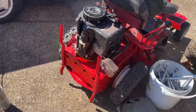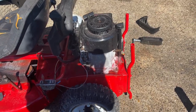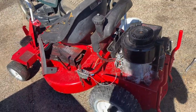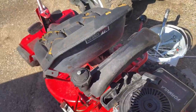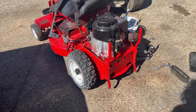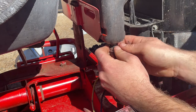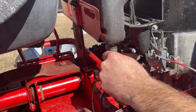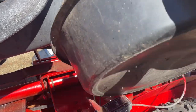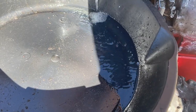So we've got a dirty carburetor - that's the problem. I'm going to try that a few more times; sometimes old gas gets in the bowl and once it gets fresh stuff from the tank it runs a little better. If that doesn't work I'll drop the bowl. I'll drain this gas out and put in some good non-ethanol stuff while I clean the carb. First stop is draining this fuel - I'll disconnect the line here. Let's make a mess and catch it in this pan. Looks like decent fuel, but I'm still putting non-ethanol in.